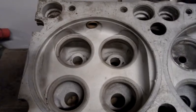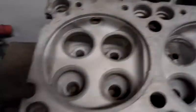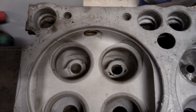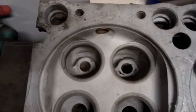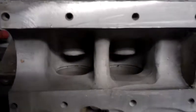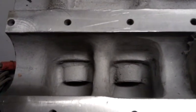What you see here is a standard Meteor head, a cut-off section of only two cylinders. This is the stock one on the intake port side, no guides on this one. If you flip it over, you can see down the intake, you can see the seat. The stock port is flat all the way in, very very large cross-section area — room for improvement, I would say.